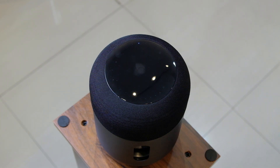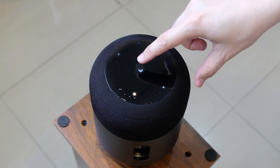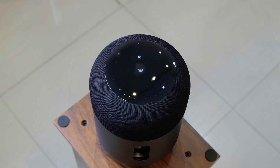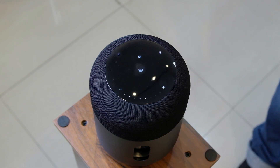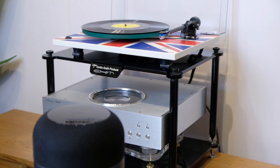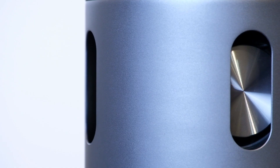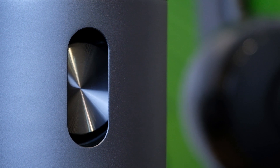Now let's look at how to select the sound filter or EQ mode. Press and hold the logo button. When you hear 2 beeps, it means it has entered Mode 2 — exiting Standard mode and entering a mode that boosts vocals. Press again to switch to Mode 3, which boosts bass. You can also use Standard mode by clicking the button once. There are 3 EQ modes in total: Standard mode, Vocal boost mode, and Bass boost mode, letting you customize the sound to your preference.